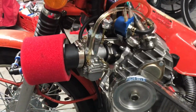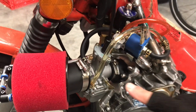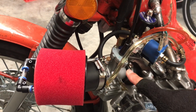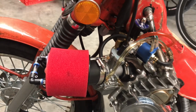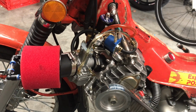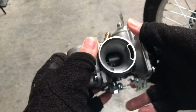I think it's goodbye for this carburetor, as I don't seem to be able to control the slide. You can make it come down hard enough, but not if you're holding a steady throttle and then try to just back off at traffic lights or something. The motor just keeps going. So I have another idea. What about a CV carburetor?